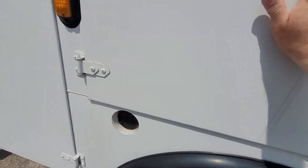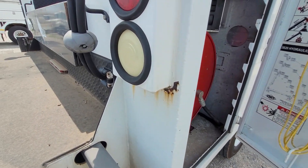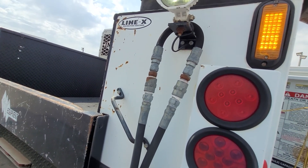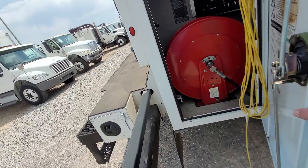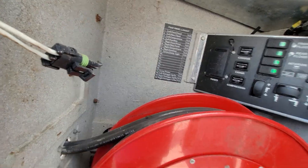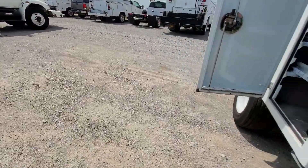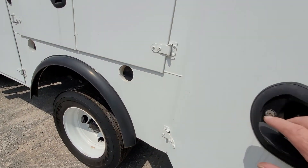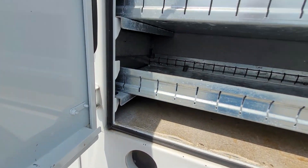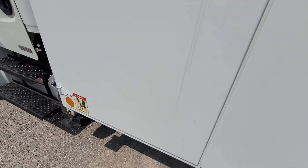I'm just sitting there thinking — that may not be a compressor. They may have been using those... look at those couplings. That may be remote hydraulics. The way they've got those tied together, I'm guessing that was remote hydraulics. So I don't know if this truck has a PTO compressor on it or not. They may have been using that as remote hydraulics to run something else, the way they've got it looped together there. I can have someone look at it and see if it's got a compressor or not.